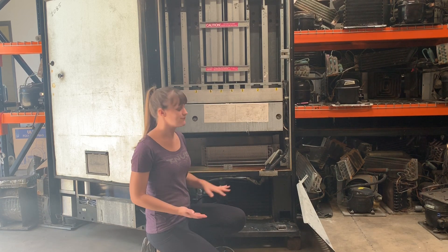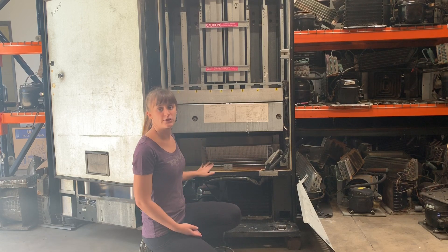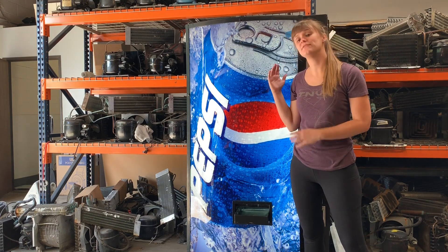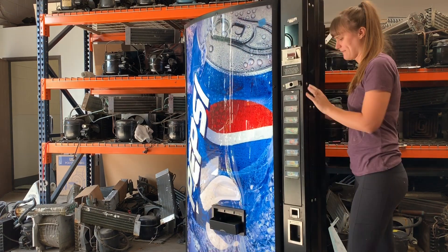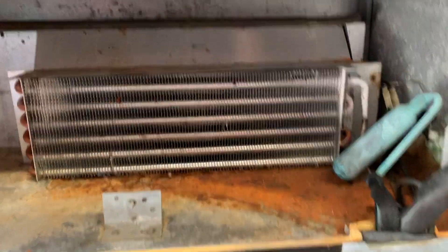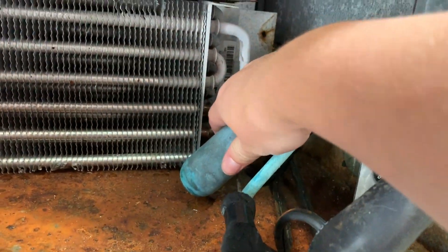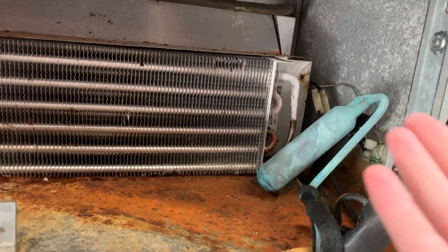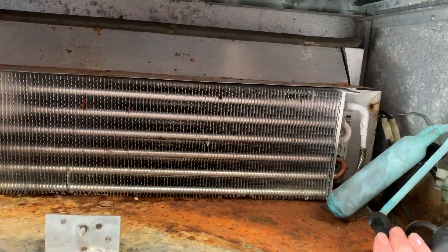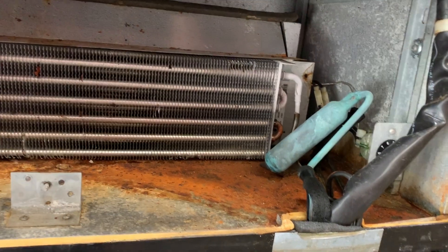I'm going to show you what it would look like if we were to have left the machine on with the evaporator fans on — what it would look like. This is a test of the exact same unit and the exact same machine, except I left the vending machine plugged in and did everything else exactly the same. Now let's take a look. We don't see hardly any frost. We see some over here on the side and on this coil, but we don't see any frost on the accumulator. It does feel very cold to the touch, but there is no frost. Now, if you didn't follow the steps of the test, you would think that this was a bad unit — but actually, this is the exact same deck and it is a perfectly good working unit. We just accidentally left the machine plugged in, so our evaporator fans are on, and we didn't get the correct results.